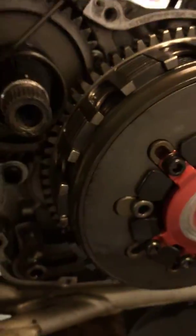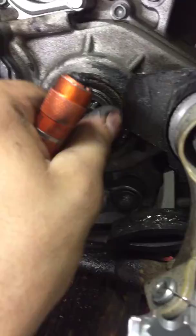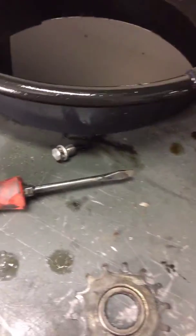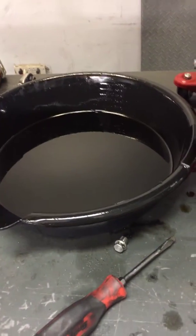I was rotating the wheel and trying to shift it, and I was noticing that all this is connected in the back there. I came over here and saw that when we were spinning this, the shaft was moving but not the sprocket. So I took the sprocket bolts off and found that there are no teeth left for the sprocket to sit on.